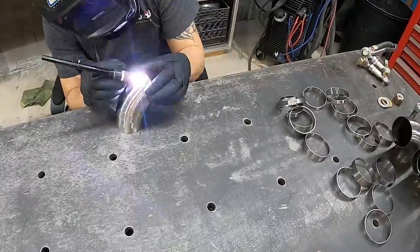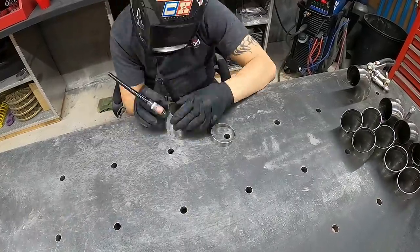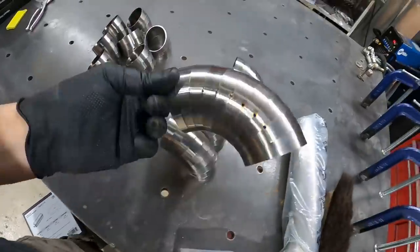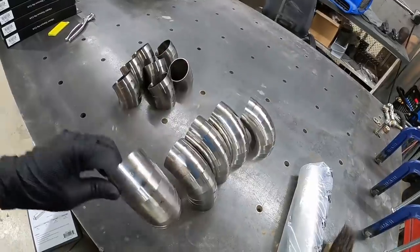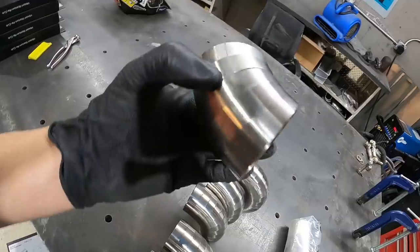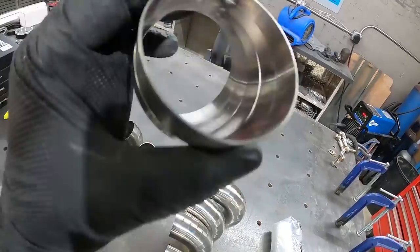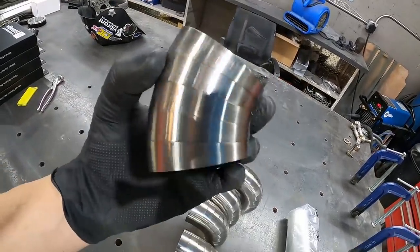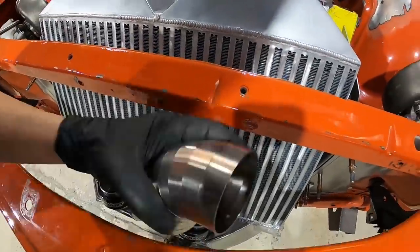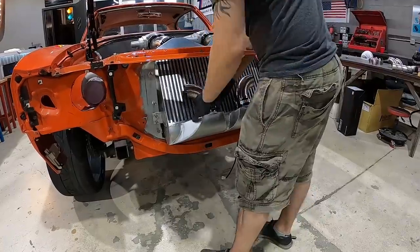You might think: pie cuts are in a bunch of little pieces — how am I going to make sense of all this? Traditionally when you buy bends like this you'd portion them into smaller 90s. What I like to do is take the packs and tack them together first to make little 90s, so now I have all these 90s and 45s ready. There's a seam on the inside because the titanium starts as a flat sheet, gets rolled, then laser cut into pie cut shapes. I'm going to tack my HD flange to my 90s first, punch a hole in this port support, get the 90 in place, and then connect the dots.